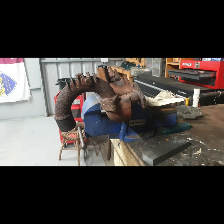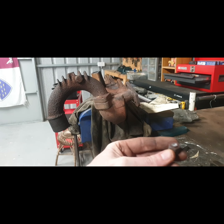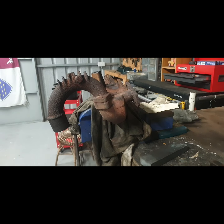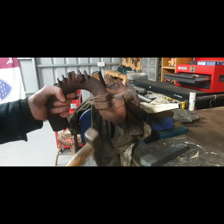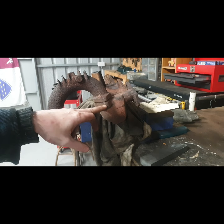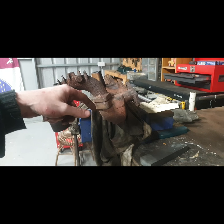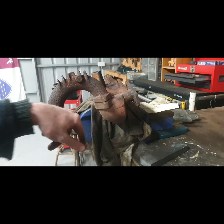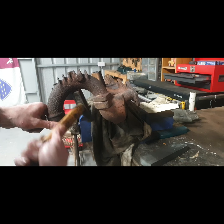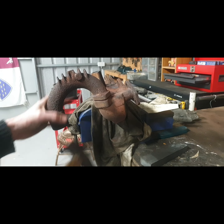There's your answer — didn't think I'd be able to break that with just a spanner. I thought I had managed to loosen both of them, but they both sheared off. So a bit of a pity, but I'm going to try and drill the butts of the studs out and try and get them re-tapped, or maybe even with a stud extractor, manage to get them out and keep the UNC coarse threads intact. This definitely hasn't been off in a long time.